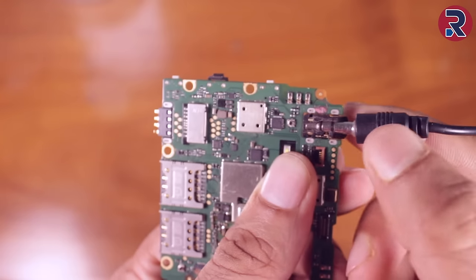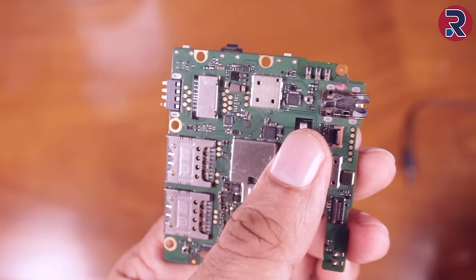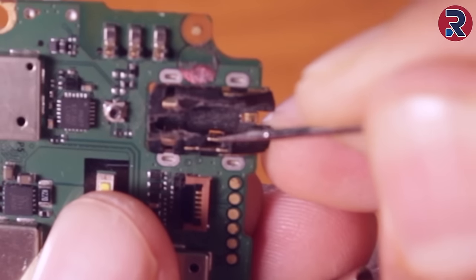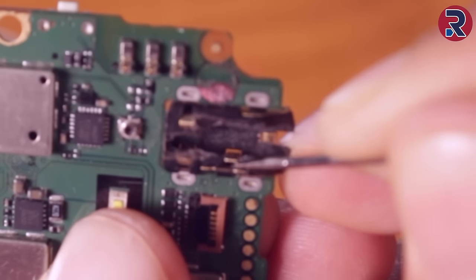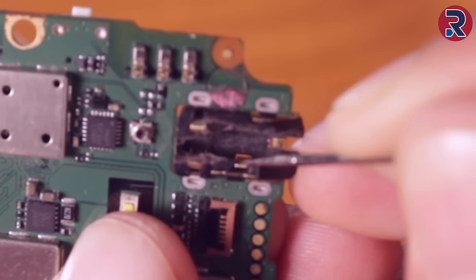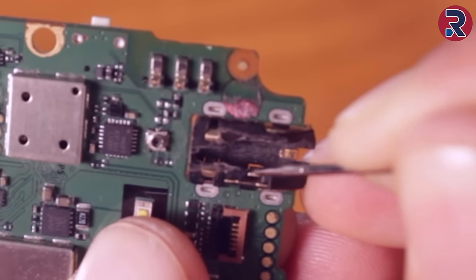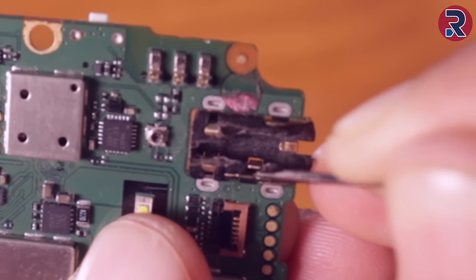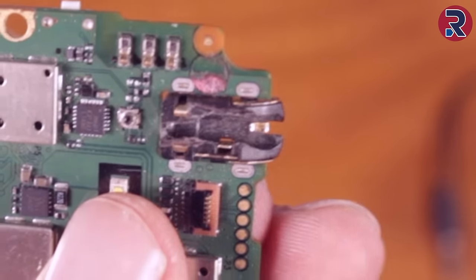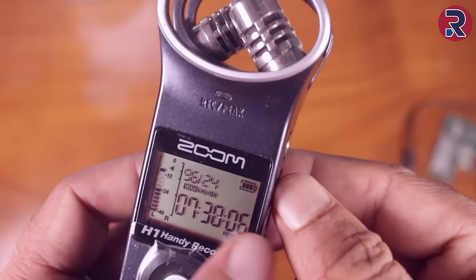But sometimes, even when you unplug the jack, your mobile shows that there's still a plug in, because these two contacts are shorted out - they're connected. And there's another port inside you can see here. It works like a relay: whenever you insert a jack it connects with this side, and by default it connects with the other side. That's the mechanism of the 3.5mm audio input jack.